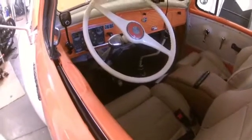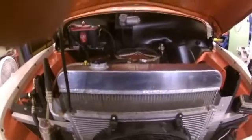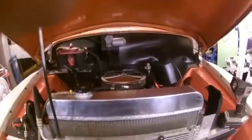So that's it in a nutshell. I'm just about done — I'm going to put a 700R4 in this, get rid of the manual five-speed, make it a little easier to drive. When I restored this I put air conditioning on it and built all the brackets for that. I also put a big aluminum radiator in it and an electric cooling fan, so there are no overheat issues at all. The truck runs well, drives good, and it's amazing how well it stops with the stock brakes. I'll stop jabbering and throw this on YouTube — thanks for looking.